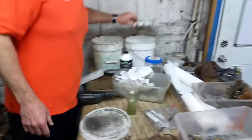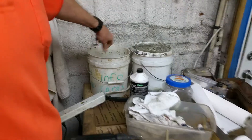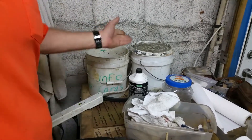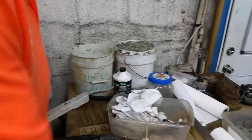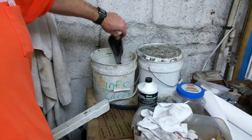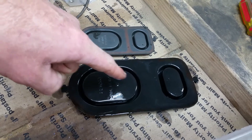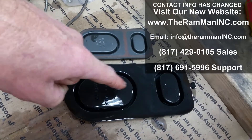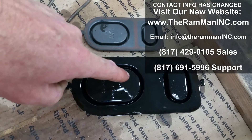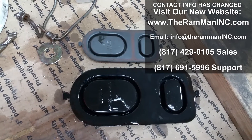Here, I wanted to do something just for fun. Here's a master cylinder gasket — an original one for a B-body — and we just dipped it in a petroleum product, just mineral spirits. There's what one's supposed to look like, and there's one after having a little bit of reaction. So don't tell me that it can't happen, can't affect anything, can't swell the seals and the cups — exactly what I showed you over there on that proportioning valve piston.